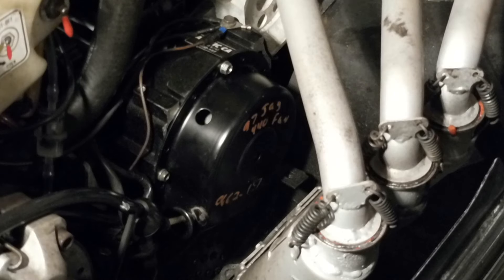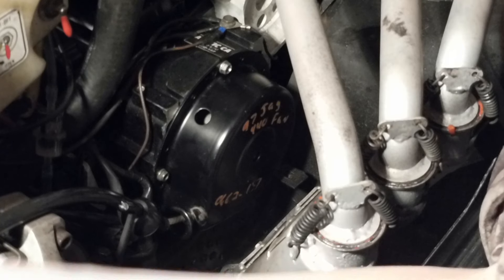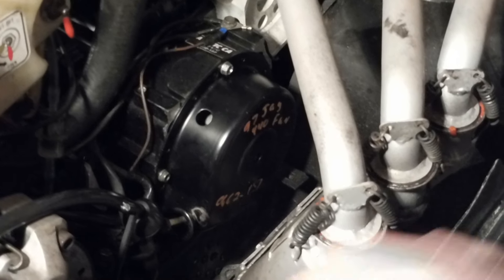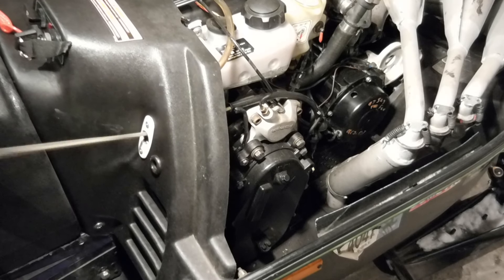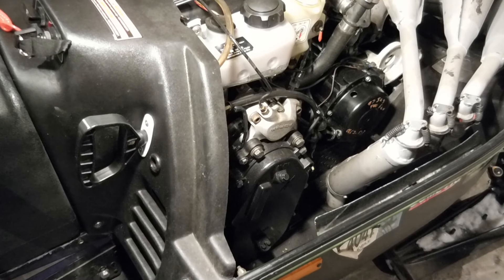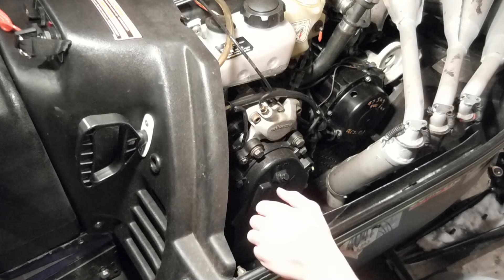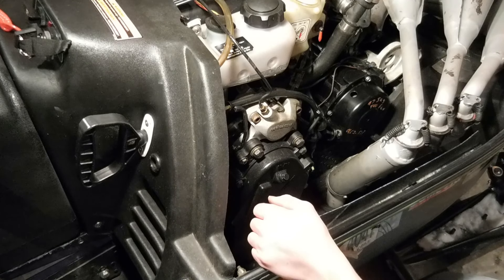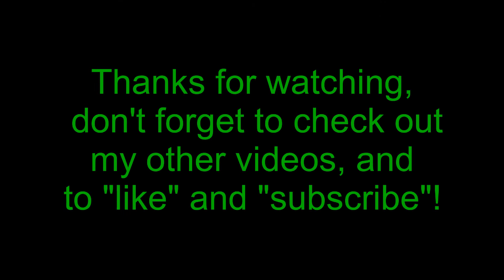Looks a lot better than having just a starter cup pulling it up to wrap a strap around — that's what I've been doing for the last two weeks, just wrapping a ratchet strap end around the starter cup and pulling it. It usually starts up in the first or second pull. So let's see if it works. There we go — seems to be working fine now. It just had a little bit of water in the rope yet, but it seemed like it just had to be pulled all the way out one or two times and then wound up tight inside the wheel. It seems to be pulling over smoothly now, so we can go riding!